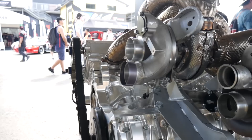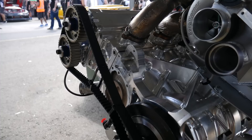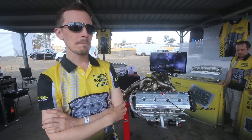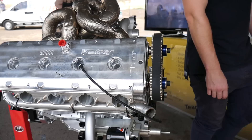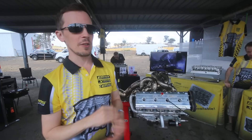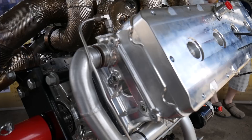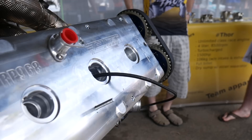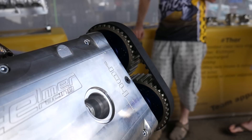For this sort of extreme cylinder horsepower level, you really need that to prevent the connecting rod from buckling, which starts eating at the lifetime. So you're limited on the amount of laps you can do. Now you said it was a quick drop — how long does it take to change a piston and con rod out? It depends on the team. You have to get the cylinder head off to get the pistons out, so that's going to take a while. But we have a complete O-ring system on this, so you don't need any sealant between those — no drying time. There is an MLS head gasket, but for the valve cover and everything we have O-ring sealing, so there's no silicone needed and you don't need to fiddle around with those half-moon-type gasket things. Just a plain round O-ring in a groove and you put everything together, so it is possible to do it very quickly.